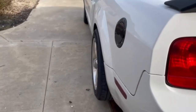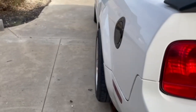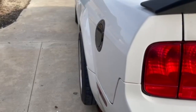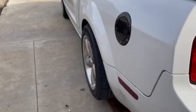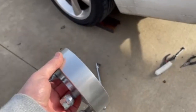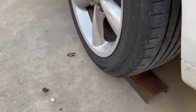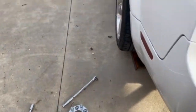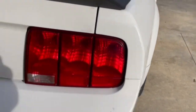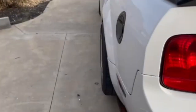I got one side of the spacers on and it's sitting about flush — sticking out just a hair. I can adjust my panhard bar to push it in a little bit if it's sticking out too far. It's pretty simple. This is what I'm using — a one-and-a-half inch spacer from Amazon. All the ones on American Muscle have been sold out for about a year now, so I just went on Amazon, found one with good reviews and good quality, and they're only about $45.